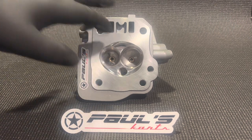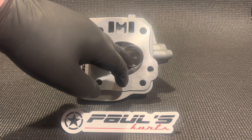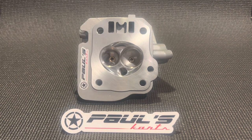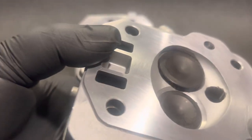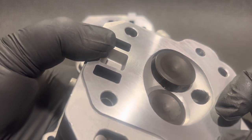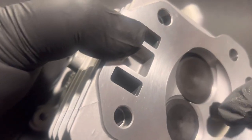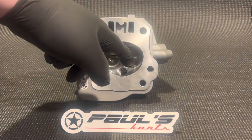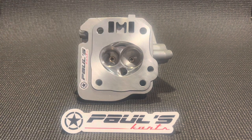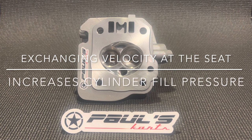If you can exchange the velocity for pressure right at the seat — the shape after the seat with that radius cut — what that does is actually helps maintain the velocity instead of it just dumping out. Say you didn't have this radius cut here and it was just flush with the chamber: as the seat opens, as the valve comes off the seat, the air would just come right out and tumble. When it has this radius shape here, it maintains the velocity around the valve. So you're actually maintaining the velocity through the port, around the seat, and a little bit more around the valve. As it exits the chamber, it can then do the pressure swap into the chamber, which increases the pressure inside the chamber — and that's where we like to do our pressure exchanges, after the valve, so that way we're actually ramming pressure into the cylinder.